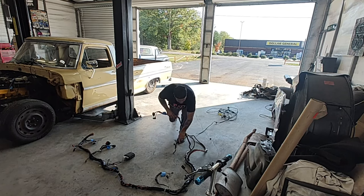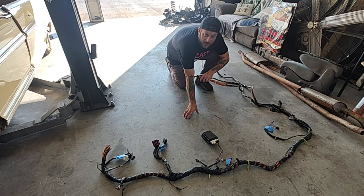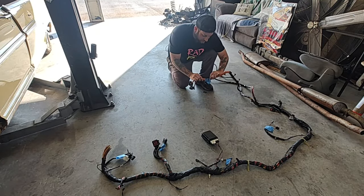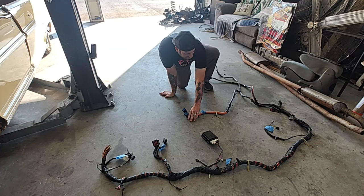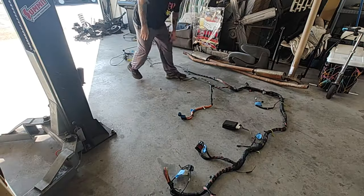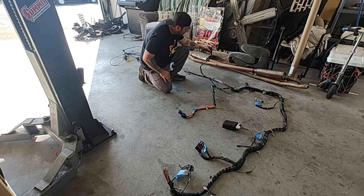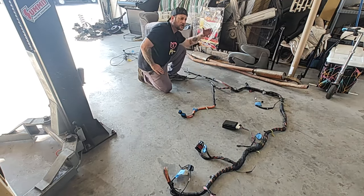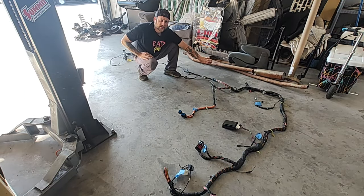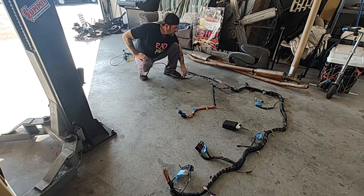Keep up with this one. When you're taking apart your Crown Vic, on top of the transmission hump in the floorboard there's going to be a little module up under the dash a little bit — these are going to be plugged into it. I've got that labeled as the module on the transmission hump. We're going to keep that. This would have run under your carpet and under your driver's seat over to that. I think this one went over to the pillar between your driver and back door where your seatbelt and airbag plugs are. I just snipped all that off — when you don't have seatbelts or airbags, you don't need it.